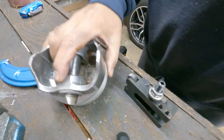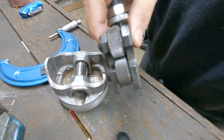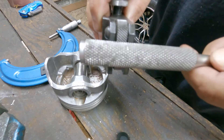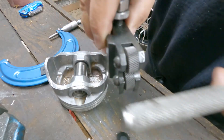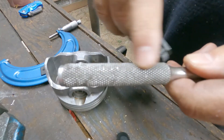If you don't know what that is, knurling is where you take a tool like this and you mount the object in the lathe and you spin it while pressing this knurling tool up against it, and it makes that knurl pattern like the one in this handle.